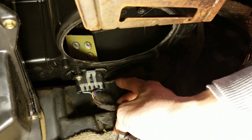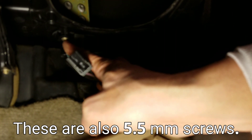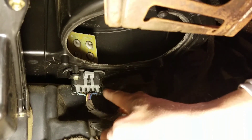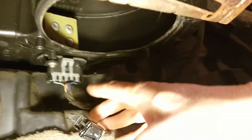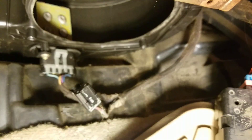To replace the resistor, you just pop this connector off. There's a screw back here and a screw right here to get it out of there. It's difficult to get back there but you can do it. There's a screw back here and right here, and then this whole thing just slides out. Put the new one in, put the screws back in. Once you get the connector out it's easier to get to the screws. Then just slide the new one up in, put the screws back in, put the connector back on, and that part's done.